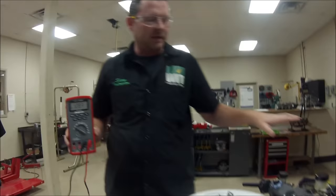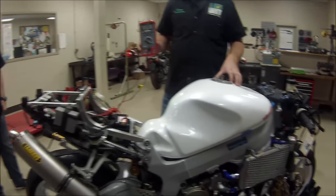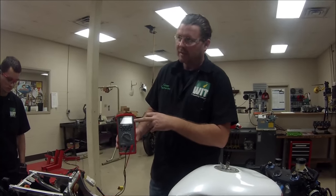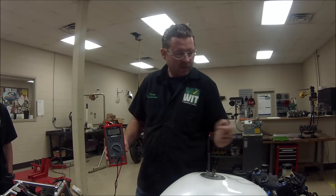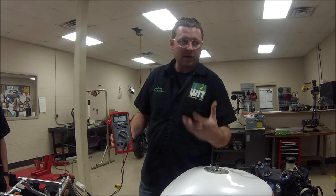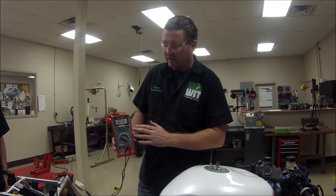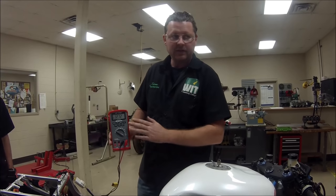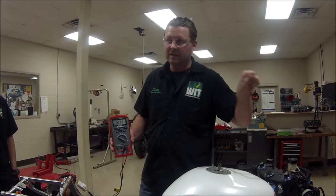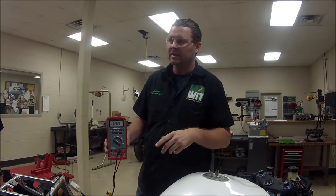This bike has no headlights or taillights — we're building it as a race bike so we don't have a lot of draw on the electrical system. At idle, voltage was jumping up into that 14, 14.3 or 14.4 range. Per the service manual, we have to run this to a certain RPM to check what's called our break-even voltage, to make sure the system isn't overcharging or undercharging. Many older motorcycles don't produce charging voltage at idle, so if you just hook up a voltmeter and don't rev to the specified break-even RPM, you might incorrectly diagnose a problem.